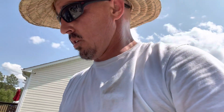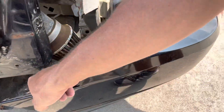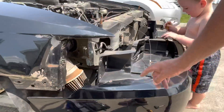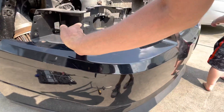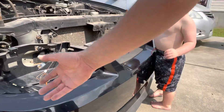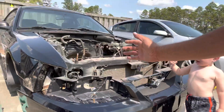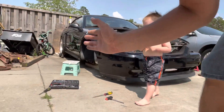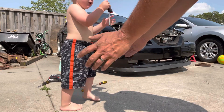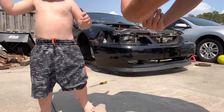Just for reference, if you ever need to take off a 2001 Mustang front bumper: there are bolts here, two bolts there — and that one usually breaks off — two bolts here, two bolts here, and the same on the other side. You pull the sides of the bumper out just a little, get it past those bolts, and then you can just pull it right off.